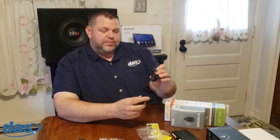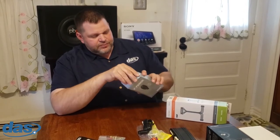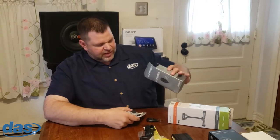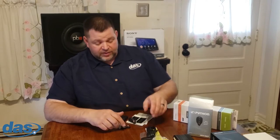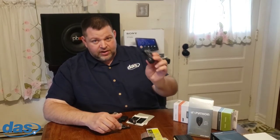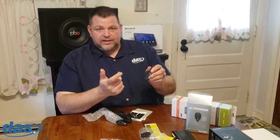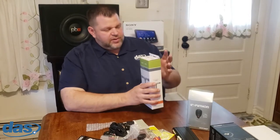The control center is all-in-one: LED and switch right on the plug. It works on that same D2D 2.0 port — plugs right into the brain on the DS3. In an application like this where I have accessories and I wanted to use a separate remote versus three-times-lock, you'll notice the remote kit does not have an antenna wire. That's because the DS3 already comes with one, so the antenna becomes the control unit.